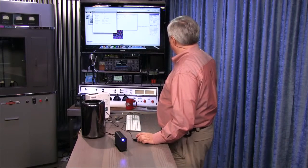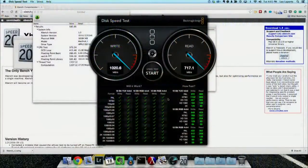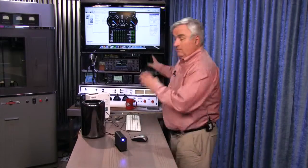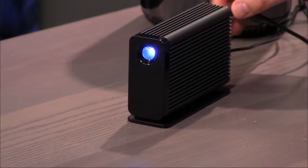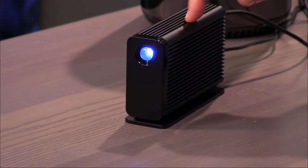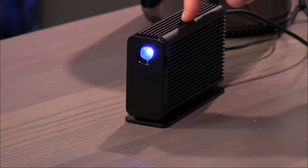I'm going to pull up the benchmarks we did on this. It's actually faster — it outpaced the ability of the Blackmagic Disk Speed Test to measure it. There's the write speed: 1,000 megabytes a second. That's a gigabyte a second write speed. Read speed is showing somewhat less, 717 megabytes a second. I think that's an error because on almost all SSDs you get a read speed faster than write speed — maybe that has to do with the RAID 0. This is really fast. I put it on a 2012 MacBook Pro with Retina display, which is Thunderbolt 1, and this was faster than the internal SSD.